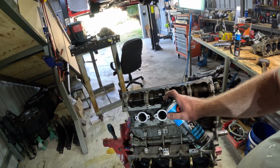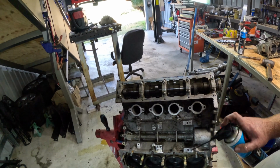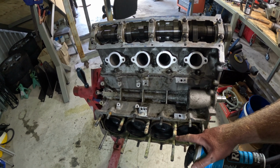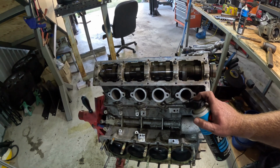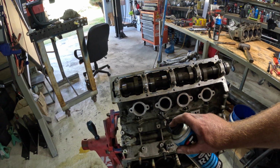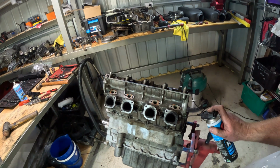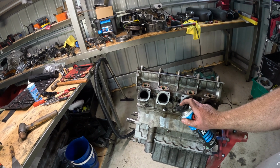and hopefully some of that will ooze down along the shaft or along the stud, and maybe make things a little easier, because that's what I think it was hanging up on the other head, the corrosion. As you can see here, the very end here, this was all perfectly clean, but it's just pulled corrosion up as I was lifting the head, and just gummed up these threads and bogged the whole thing. So, because I really don't want to be using such crude methods as paint scrapers and screwdrivers to lift the cylinder head off on this thing. Hurts my heart. So it's soaking right in on these ones.